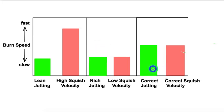Ideal power for the engine is with correct jetting and correct squish velocity — a little leaner than stock and less piston-to-head clearance than stock. The other end of the spectrum is lean jetting and high squish velocity. If you bring the squish velocity to a very high level by bringing the clearance to its bare minimum, testing will show you need overly lean jetting to get best peak power, which leads to excess engine heat and makes it more likely to seize. This is what a lot of race mechanics have done without really understanding where squish velocity should be, which is why I highly recommend my squish calculator — it helps you get the right velocity as well as the right volume under the squish.